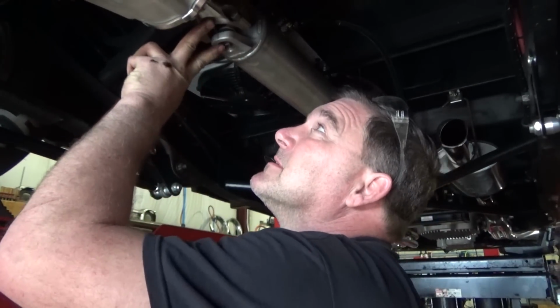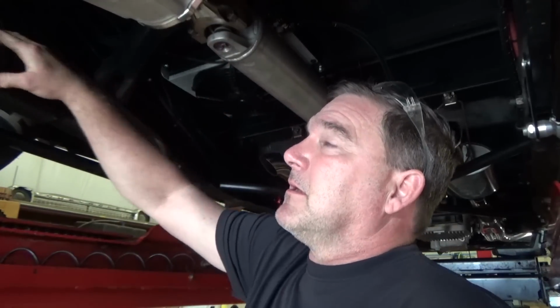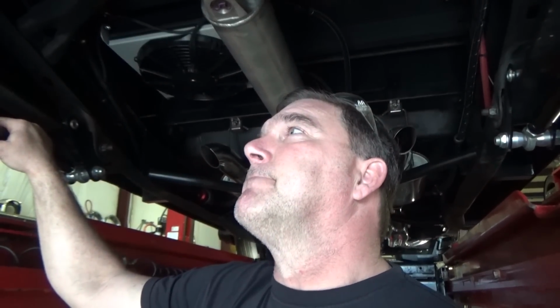Next order of business is his driveline pinion angle. His pinion angle is actually negative. That's not optimal. So he's either going to need to get different shims between his axle and leaf spring. They make different wedges. Or he can raise the back of the transmission. But it needs to go up like 6 degrees because it's actually 3 degrees negative. So the pinion's up 3 degrees. The pinion needs to be dropped down 6 degrees to get 3 degrees positive.